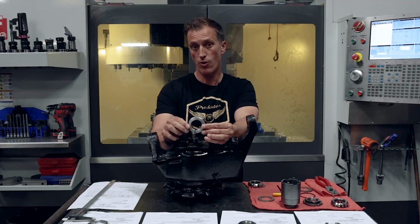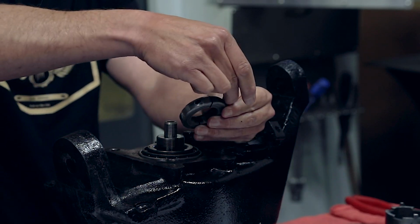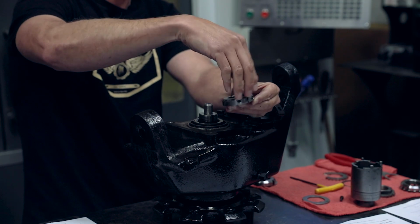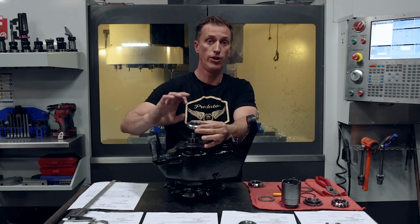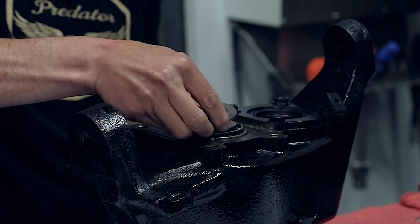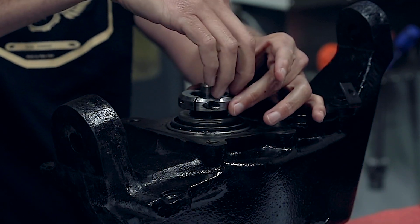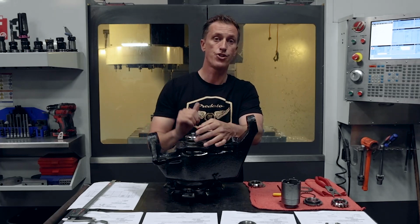This again is the H1. The Revision B is very similar in that the slot goes halfway across here, and it has 3 set screws that go down from the top and tighten it down, pinching it off on one half of the threads. So it is truly locking in place. And in that situation, you put your slotted washer in place, you tighten it down to the correct torque specs, and then you set the screws in here to the correct torque specs, and it's not coming off. That one is a true locking one.